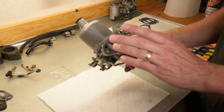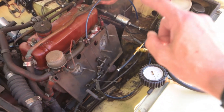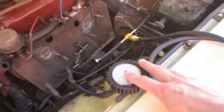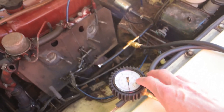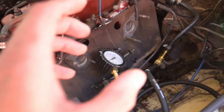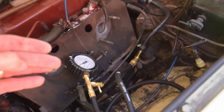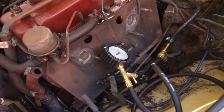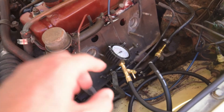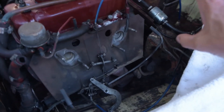Before we put in the carburetors, we want to test the fuel pressure — we're not sure what the fuel pumps are doing. We rented a fuel pressure gauge and hooked it up to the fuel line. We're using a gauge that is for fuel injection so it reads much higher pressure. Since we're only trying to get a couple psi, there's barely any reading with the fuel pump on, so I think we are good — we don't exceed our pressure. Now we're going to get the carburetors installed.